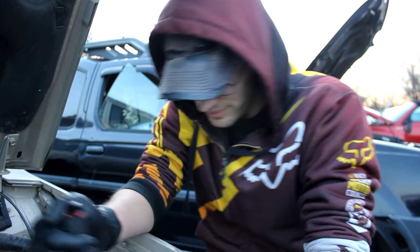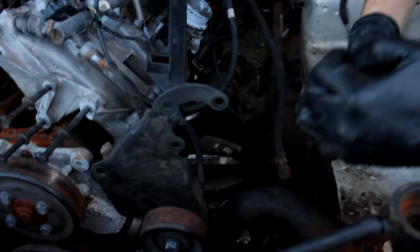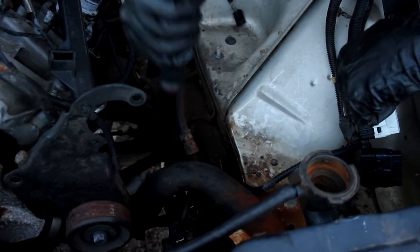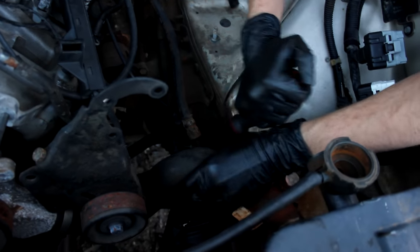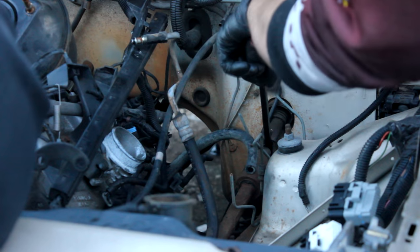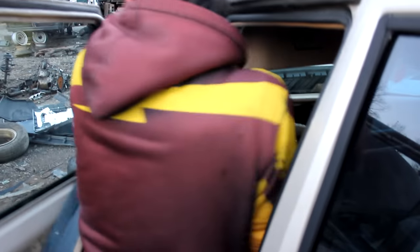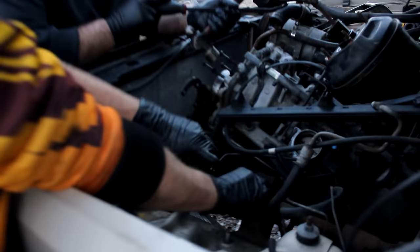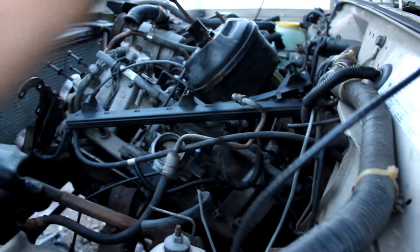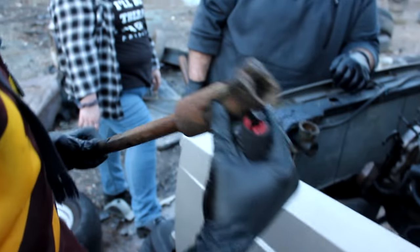I think I moved it a little bit, because it's like half an inch off now. And after not a small amount of effort, eventually we gave up on collapsing the shaft and just unbolted the steering gearbox. That allowed us to pry loose the lower end, and then, again, eventually, we were able to pry loose the upper end and completely remove the intermediate steering shaft. Ha! Yes, that is the right kind.